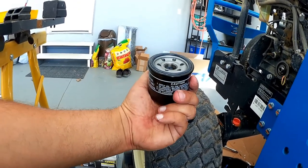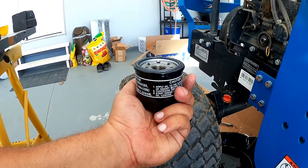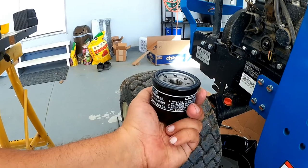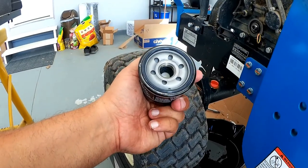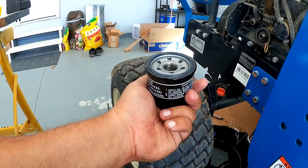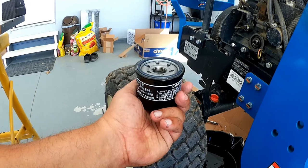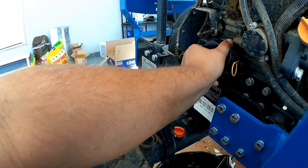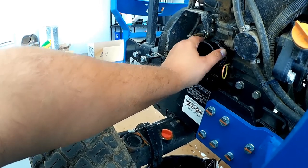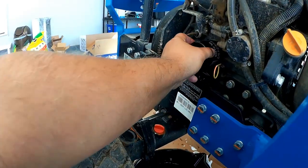One of the things I've done — the oil filter does go on sideways, so if you were to fill it up with oil, you're going to have a short period where it runs dry as the oil pumps through the system and it would pour out. What I do is pour it about quarter full and then rotate it around so it saturates the exterior filter. I also put a little bit of a bead around the rubber gasket as it goes on to the motor so it seats there. I'm going to finger-tight this on the cleaned surface, making sure not to cross-thread it. Then I'll put it on hand-tight and come in from the front with my oil wrench and tighten it until it's simply snug.